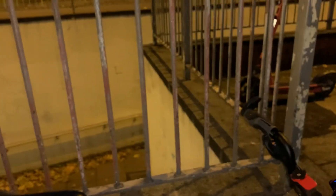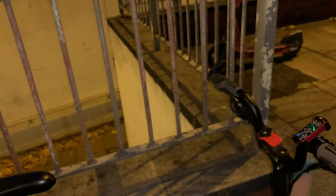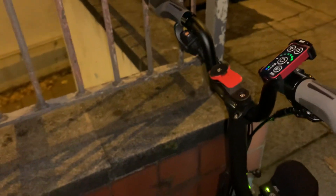One thing I'm aware of when riding a Sturmey Archer hub bike is to ride in second gear, because that gives less wear to the hub as it's direct drive. That doesn't matter here because it's a P-line and it's got four direct drive gears anyway.